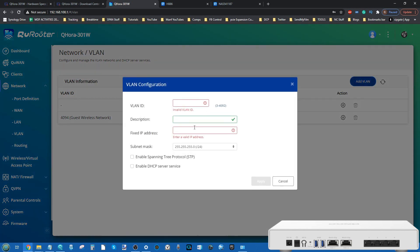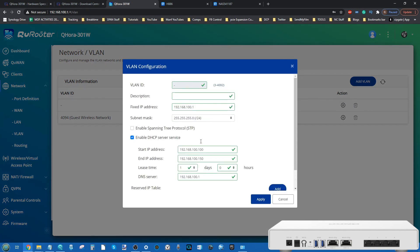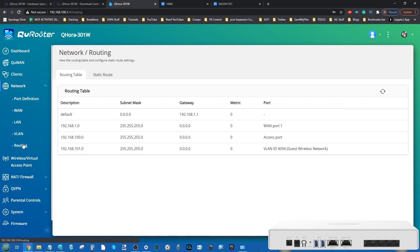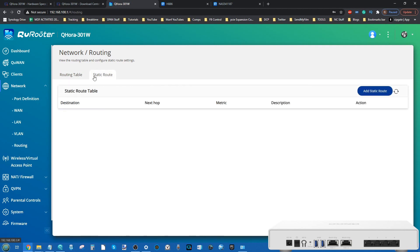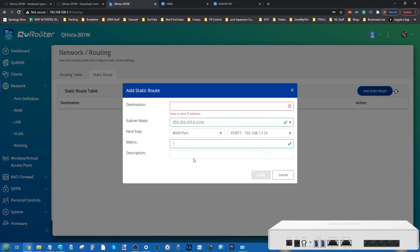These options, though very user-friendly and well-presented, do feel a little shallow once you dig deeper. Virtual LANs let us create virtual sub-networks — going in, we can designate individual ports to a VLAN and create trunks. It's nice to have those options, though most users won't go down this road unless they're a business user. You can alter preset VLANs with their own IPs and add LAN ports, change routing options, configure DHCP or static routing, and assign values to individual ports.